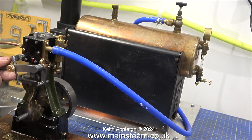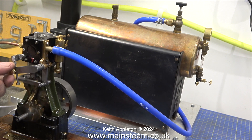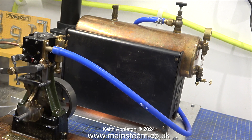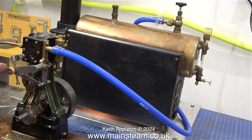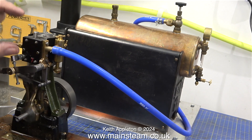Move it towards reverse, which is notching up. Now the engine will not sound as good, but listen to the blower getting louder — because the engine is now using a lot less steam as the valve is not moving quite as much.